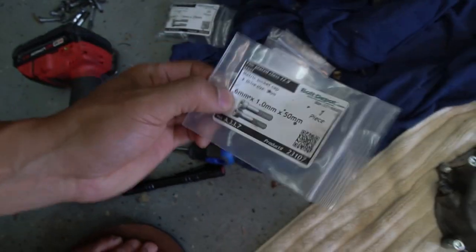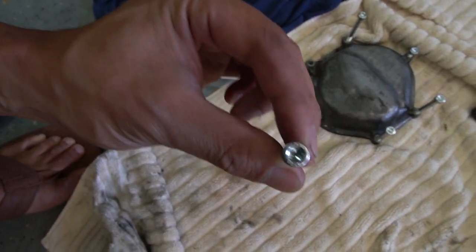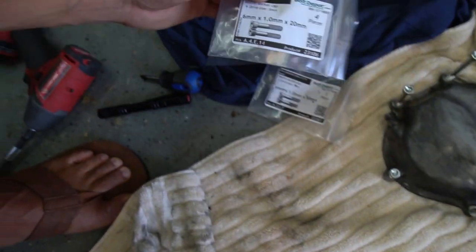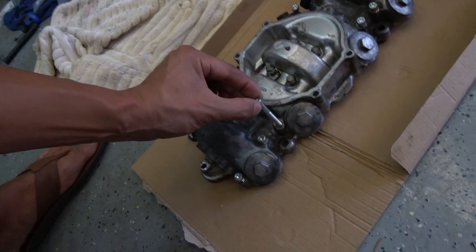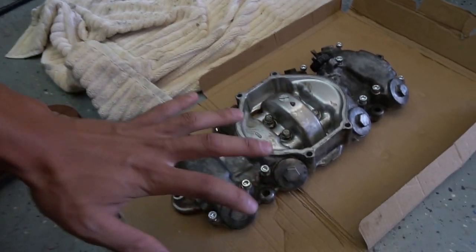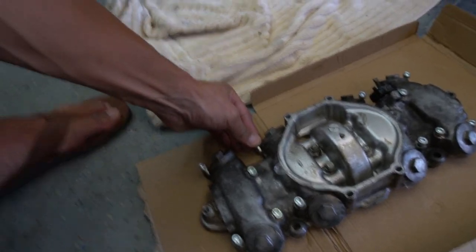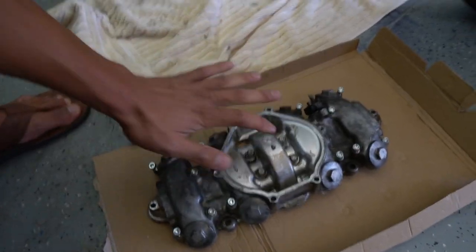During the time-lapse, you noticed I was holding up all these different packages. What I was trying to do was replace these stock Japanese standard screw bolts with brand new shiny socket cap bolts. I wanted to show you the size, length, and thread pitch I was using for my build. Because these bolts come in so many different sizes, I made sure I had the new ones ready before I took the whole thing apart. Here's a trick: when you have a job with a lot of bolts, grab a piece of cardboard and create a mock-up map of where these bolts go. Put the piece on top, make an outline with a sharpie, then push the bolts through the cardboard.